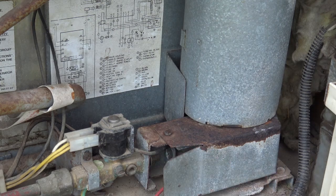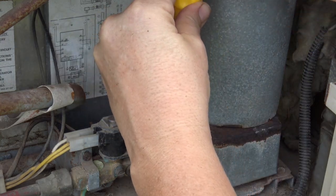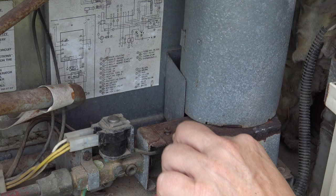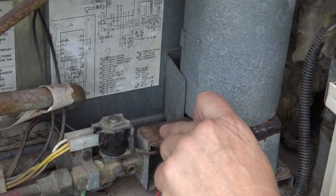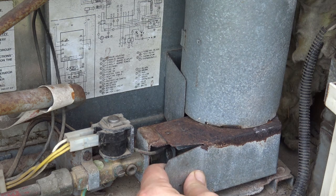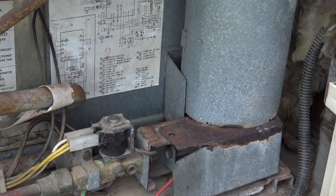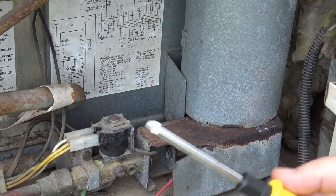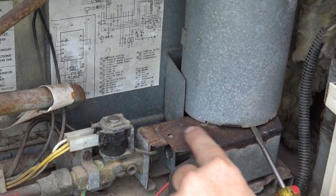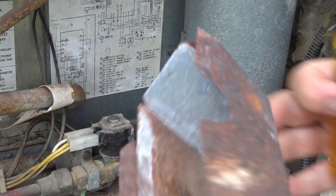Now that this is cool enough to touch, I'm going to take off this, which is the burner cover. The first time I tried to do this, I unscrewed it, which was really easy. That told me it had been cleaned recently because this screw, you can see it's pretty rusty — that should have been a lot harder to get out if it wasn't taken off recently. So when I took it in, I do believe they took it apart and cleaned it. Then I started pulling on it but I couldn't get it out, and I was afraid to pull too hard. I got a screwdriver, stuck it in, and propped it up to see if it was connected to anything, and it wasn't, so I used a little more force and it finally came off.